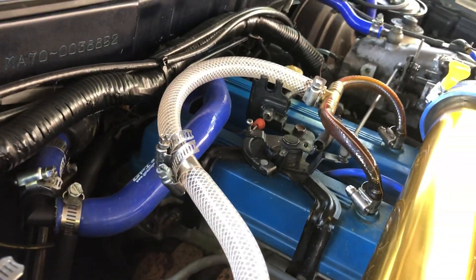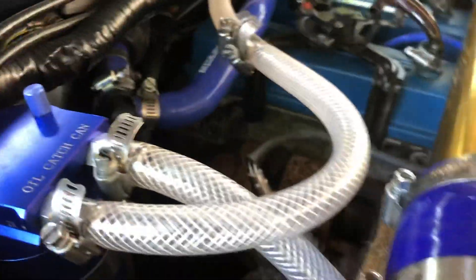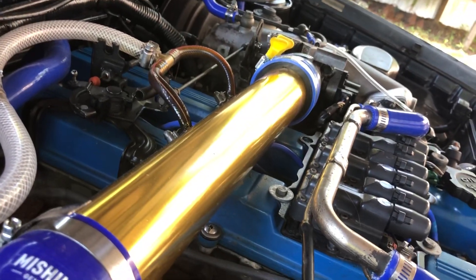So yeah, it's a lot better on your engine. But another thing — it keeps the hot air from going right into your intake, because when it comes in and goes back out into this intake, it has to go down through the intercooler and come back up through here to get to the intake. So it's cooling it down too.